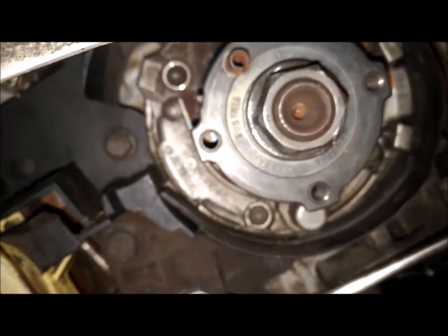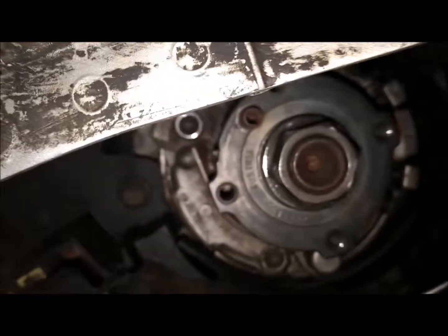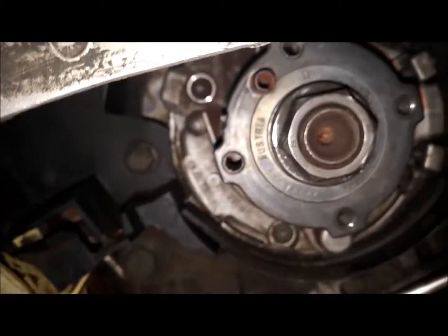Makes no sense. But I think I'm going to set it up the way the old man taught me to do — put it at top dead center, mark where that mark is, leave a mark out here showing where that's at, and try it from there.